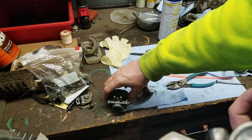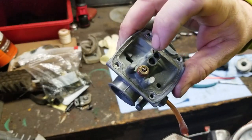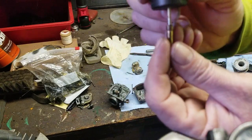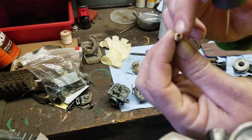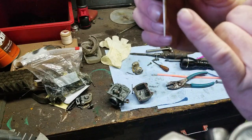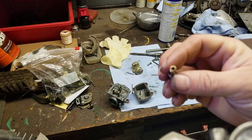It comes out of the pilot jet, all right? And it uses the pilot jet from idle to a quarter throttle. After a quarter throttle, this right here opens up, and then fuel starts to come out of here, around here. So you want to make sure that your needle and your guide or your orifice tube is clean and smooth, and that your needle is straight. Okay, these are very important performance problems that occur with carburetors, and they're very, very much overlooked.